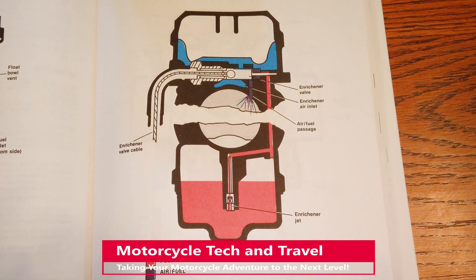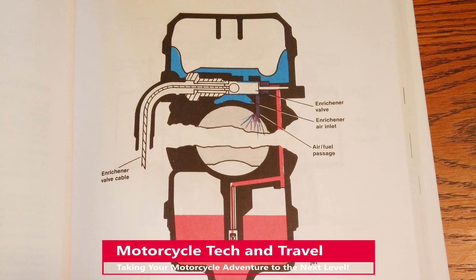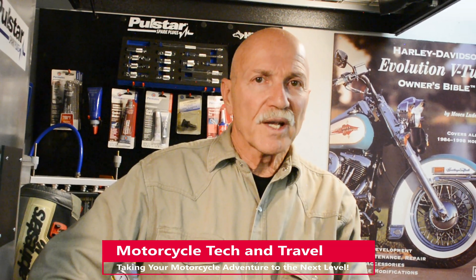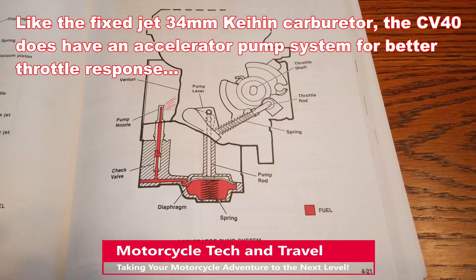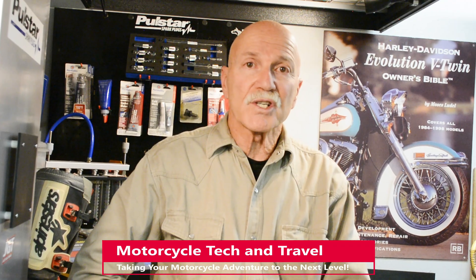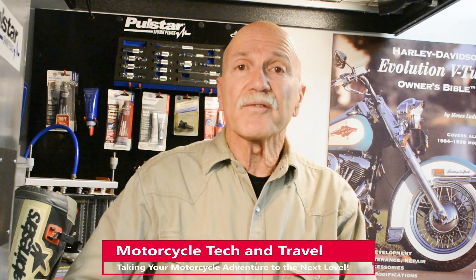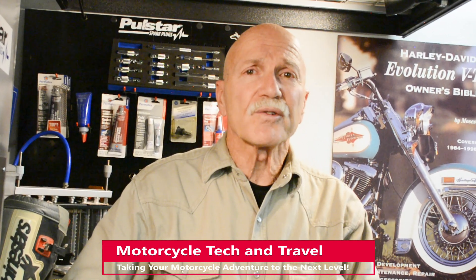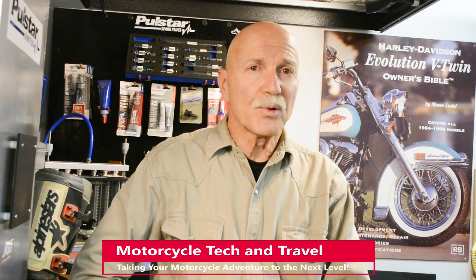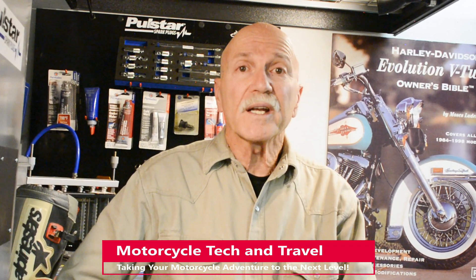For cold starting a 1988 to 2006 Sportster with a Keihin CV40, there is a fuel enrichment or choke circuit — the CV40 does not use a choke butterfly valve like the earlier fixed venturi carburetor. Key adjustments and tuning options on these Keihin carburetors are the float level, pilot or slow jet, and the main jet. In the factory shop manual, jet or needle position changes are not mentioned for the CV40, as it is an emissions-regulated carburetor. For altitude adjustments on the 1986-1987 fixed venturi carburetor, replacing the main jet is advised at 4,000 feet elevation. The channel's home base is 4,100 feet, with local riding going to 8,000 feet.